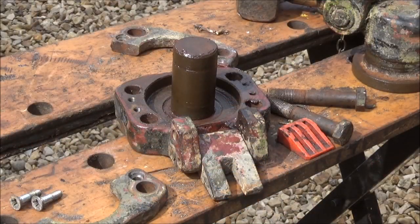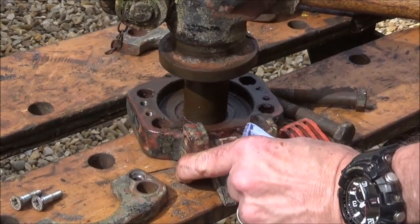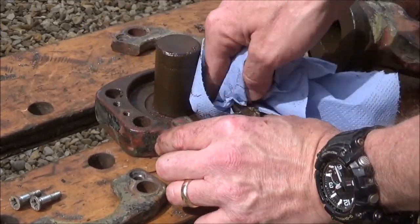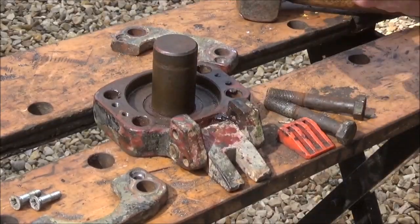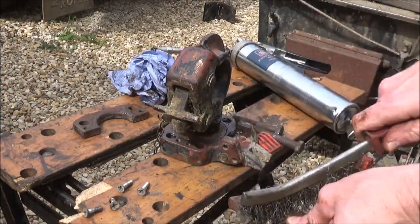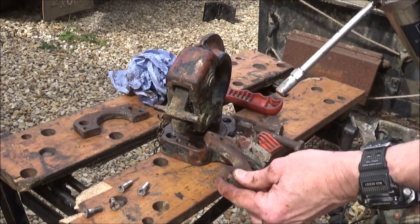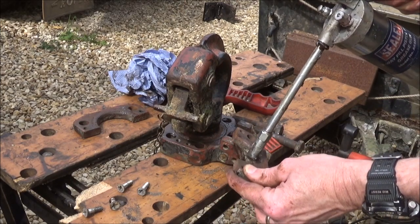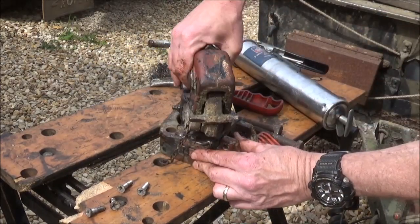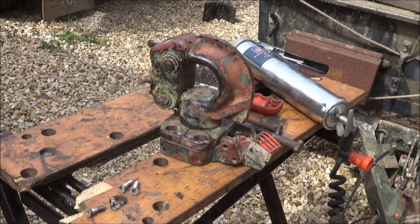There you go — and there you have it. You actually need to clean as much grease off this as you can, because what happens is it slides over the top and it needs to be as far down as possible. Currently it's a little bit proud so just get as much of that grease out and then slot that over the top. Nice and free moving. We're just going to give the plates a little bit of a clean up with a wire brush — they're not corroded very much. Put a little bit of grease on it for lubrication, slide that in, same with the top one. Spin the hitch around so it's correct, not the wrong way obviously, and then put the screws back in.